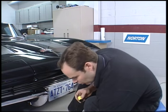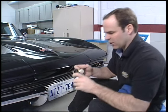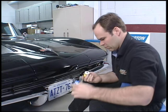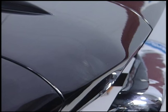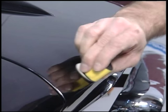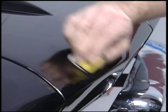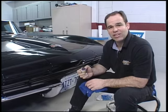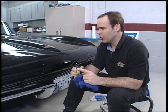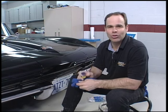It's still a little hazy, so we're going to go to a finer foam pad and a finishing compound. This is actually colored, so it'll help hide any fine imperfections. The kit comes with four different pads, two different compounds, two different grit sandpapers, and this little handheld thing that everything attaches to, so you can do it at home, do it in the garage. You've got a perfect repair for your little stone chips.